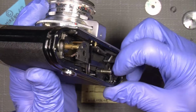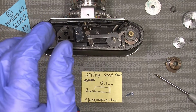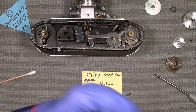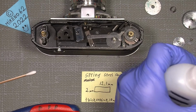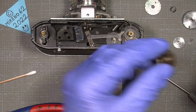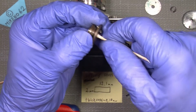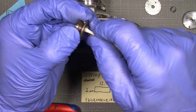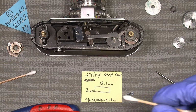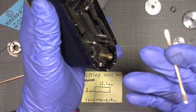And I think I will just give it some light lithium grease. Maybe I will use some Liqui-Moly or so. Should be light grease. And I will just use some isopropyl alcohol to clean a little of the old grease away. Shouldn't be that much. In that way here. Wow. It looks like they use some molybdenum disulfide on the axle. We can also do something to the axle here, I would think.